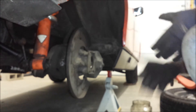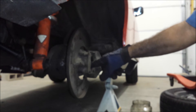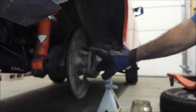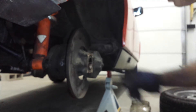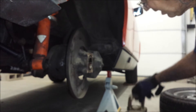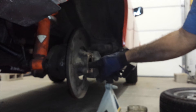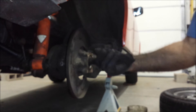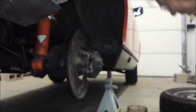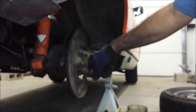The point is that we've got it out of there now. We're ready to take off the cover — ooh, that doesn't sound good. We're ready to take off the cover and then we can work on taking the bearing out. Obviously you can see the bearing flange is now off. Here's our bearing exposed. Look at that — that doesn't look good. It might be okay, but it seems like there's a lot of slop in there. So now what we're going to do is go from the back side, and we have another bolt with a nut on it, and I will tap this out from the back side.